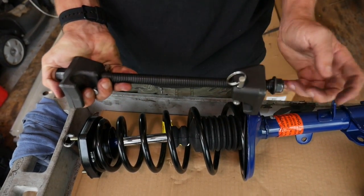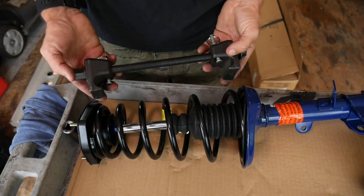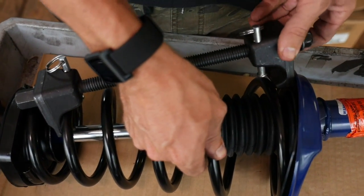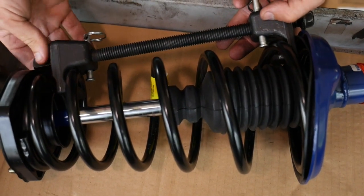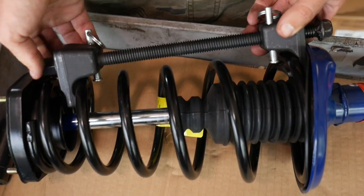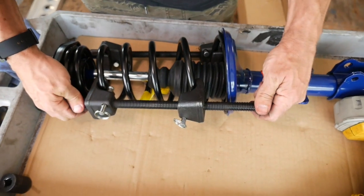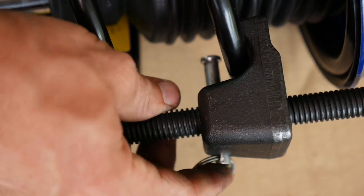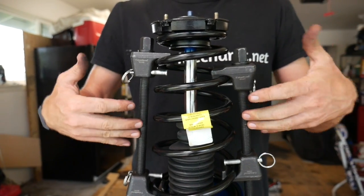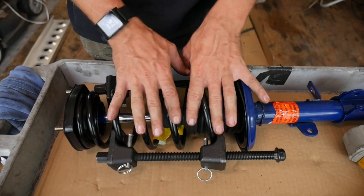On this one I modified it a little bit — I actually welded a nut to the end so you could put a wrench on either end. If you don't have that, just make sure that whatever position you put this on, you can still get a wrench on your main bolt. You kind of want to grab the spring as close to the ends as possible so you have the most travel. Once it's slid in there, find a position where your nuts aren't going to bind up. Go 180 degrees opposed to your other side. Most of these are going to have some sort of safety you can push through to keep it from hopping off the spring, so make sure they're as close to 180 degrees from each other as possible so you take it down evenly.